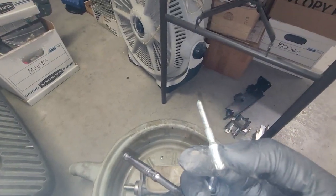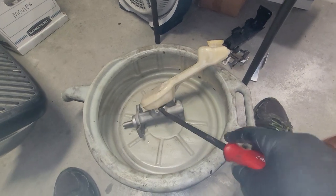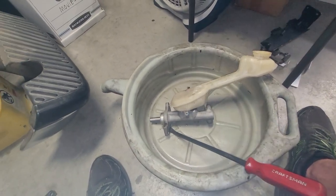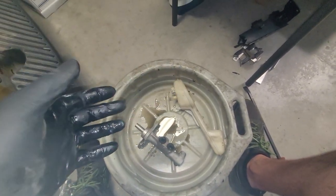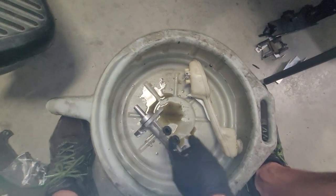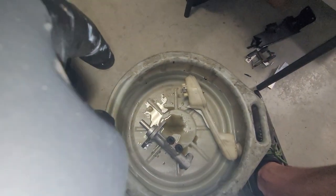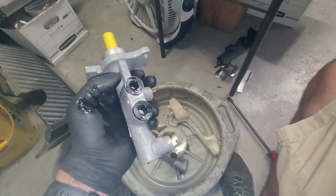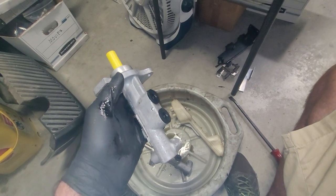The pin is removed — just a little bolt. The brake reservoir just sits on top, so I'll come in with a pry bar and pry up on it using two hands. It should just sit in the top of the master cylinder body — there are two ports. The reservoir is going to get reused and the master cylinder gets replaced. The new one came with a new o-ring on the booster side. I sprayed a little bit of lube in the ports so the reservoir goes on smoother. We'll pop this together, put the pin bolt back in, and then bench bleed it.